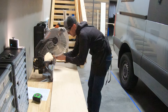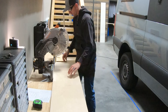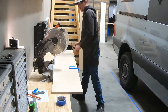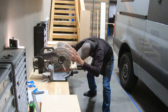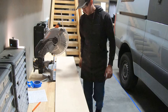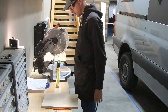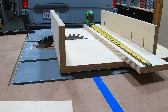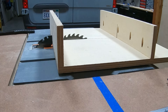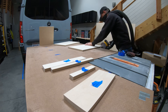Next, I took the boards to the miter saw to cut them to length. The boards were a bit too wide to cut through in one pass, so I set up a stop block, made the first cut, and flipped the board to finish. A sliding miter saw would have fixed this, but I don't have one — this is how you tackle it with a standard miter saw. I finished the smallest boards on the cross-cut sled on the table saw, then ran the sander over all boards with 280-grit sandpaper.